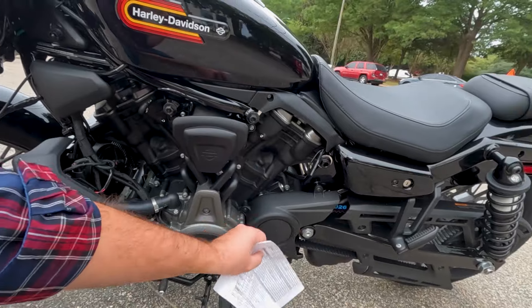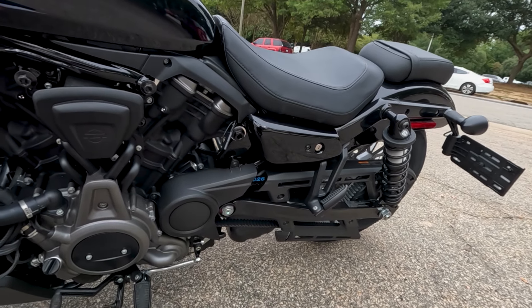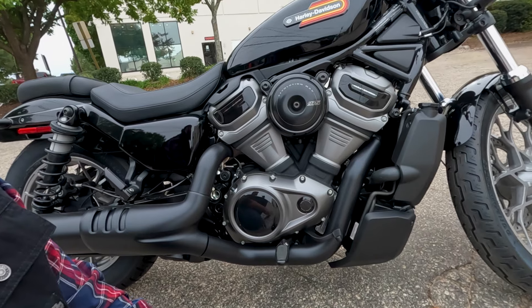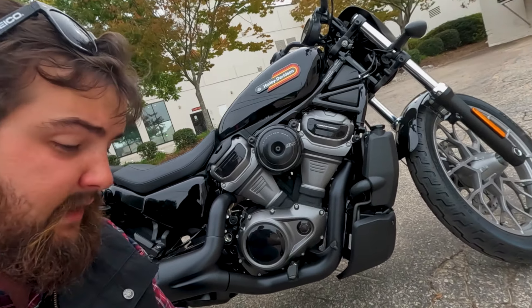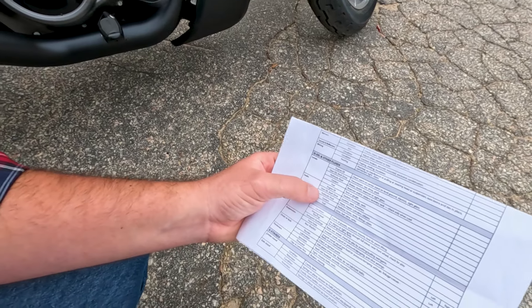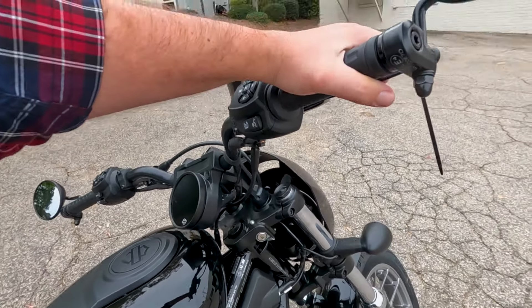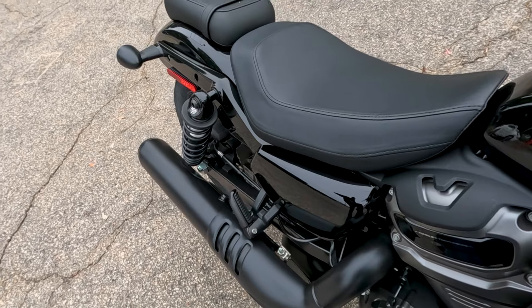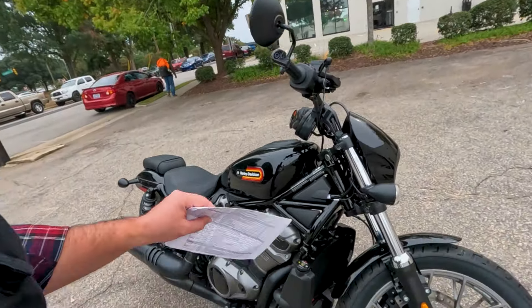Let's see mirrors. While you're parked and you've got your gear on, go ahead and get on your motorcycle, make that adjustment to your mirrors, and then ride out. If you're riding and you realize you need to make an adjustment, it might be safer to wait until you're stopped next. Then our lenses and reflectors — we've got good reflectors here, they're not cracked, not falling off. The lenses on everything are also plenty fine. That'll make our bike a little more visible to other riders and especially to cars if parked on the side of the street. We want to make sure our wiring looks good as it's going everywhere — nothing exposed, everything looking nice and tidy.